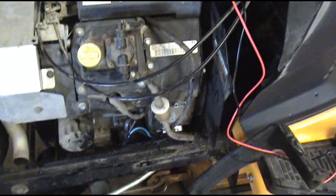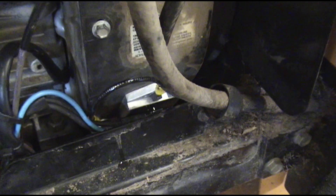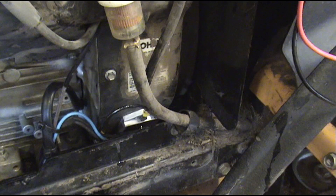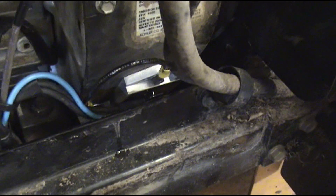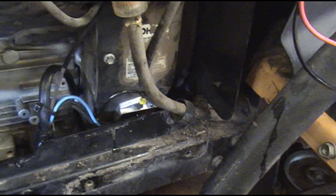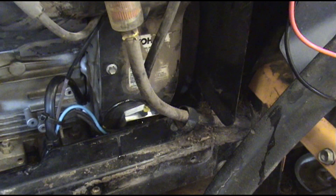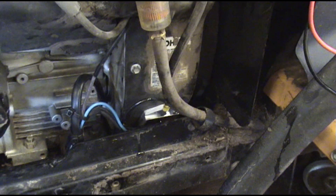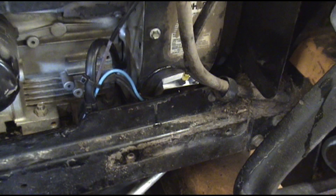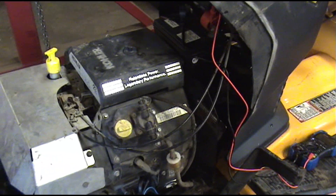The stator's working, the regulator's working, and the battery's charging. It wasn't an easy job, but most are not this hard. A lot of times it's just the regulator — your stator passes the test and the regulator fails; in that case just put a regulator on and retest. A lot of non-charging problems are either a bad regulator or 12 volts not being able to get to the system. That's why we always test that lead to see if it's hot. Probably at least half the non-charging problems are the voltage regulator.